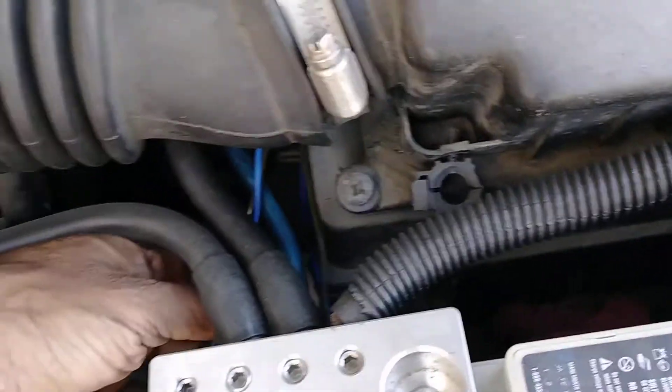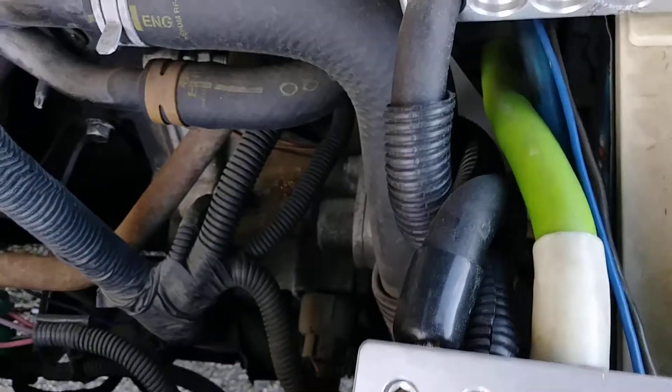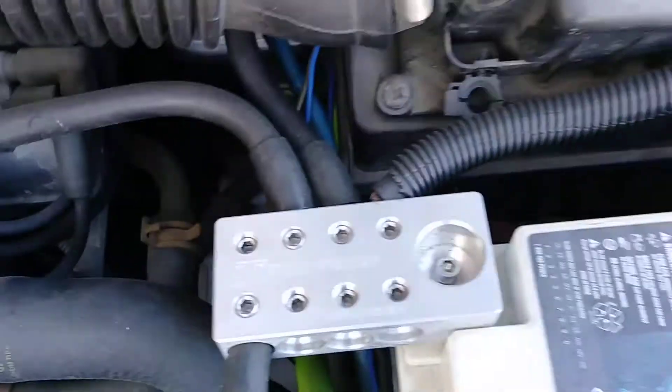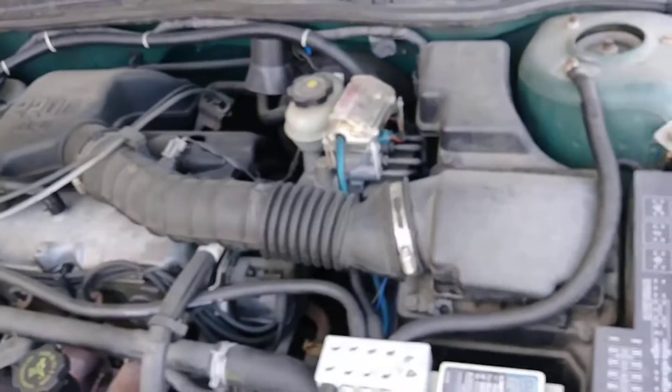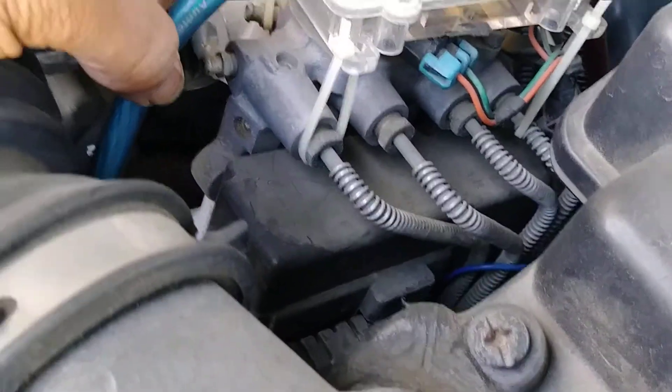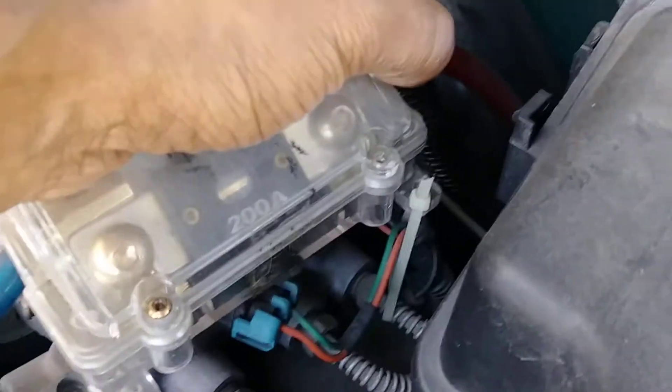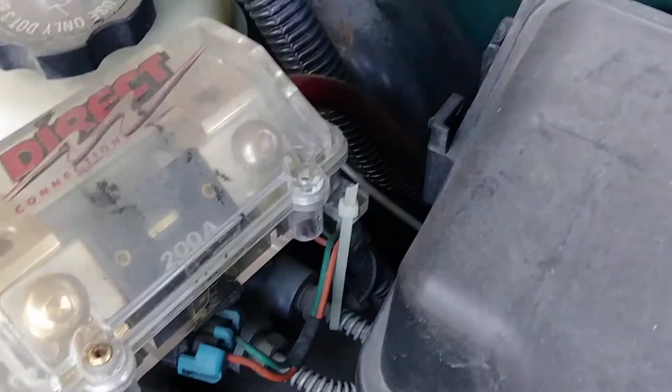As you can see, I don't think it's hooked up to anything — no, it's not hooked up to anything. It's sitting down here, right here. That's the 4 gauge that the car very first started out on that I have yet to take out. And as you can see, it comes in as this wire, this blue wire, and then runs to the back in this red wire through the other side of this fuse block. However, I do need that 4 gauge fuse block.